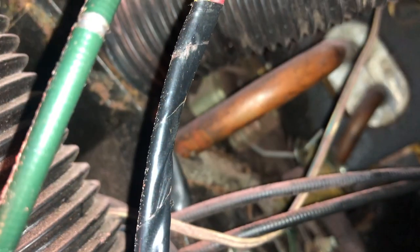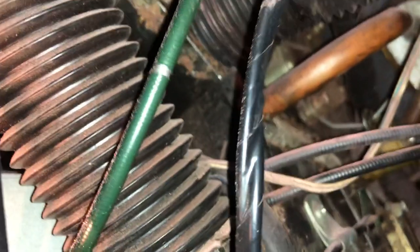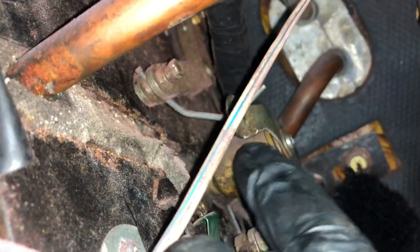And looking further underneath, there's a bit of a strain trying to get underneath the car and craning your neck right up to the top. In the distance there you can see two brass pipes, and those are the pipes coming in from the bulkhead that we were looking at just now. And just behind that top one is what I'm interested in, which is the valve that adjusts the heating to the heater matrix, the flow of water basically.